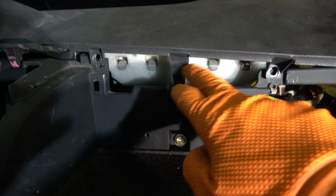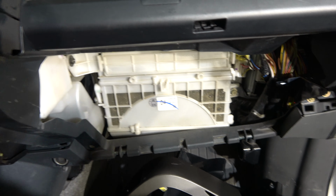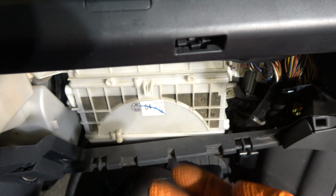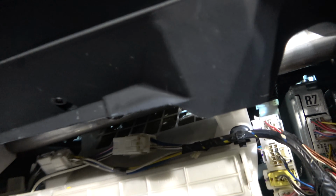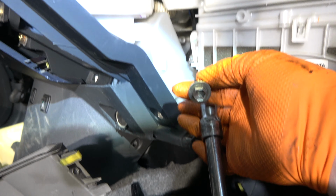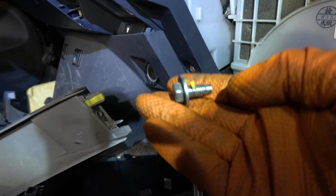After that there is the front airbag, and this is a little bit difficult job because we have to take this glove box away, and in here when we look in this upper area there are 2 bolts below that panel, and we open these bolts on that side, and in that area we can maybe see these bolts in there. There are 2 in here, and soon I take these bolts away. They are 12 millimeters. Okay, and here we have this bolt, it looks like that, and 2 of these 12 millimeter bolts, small bolts in here.